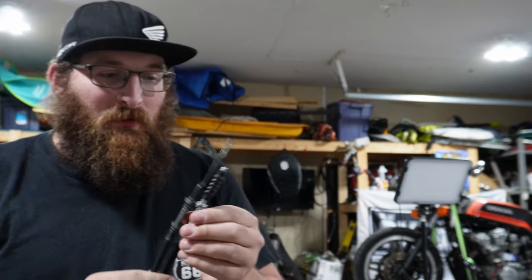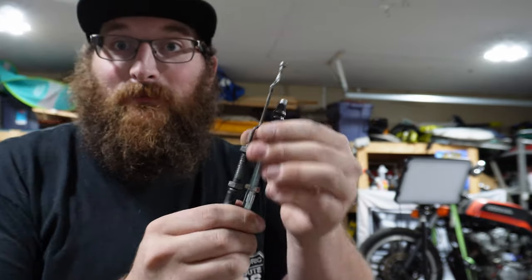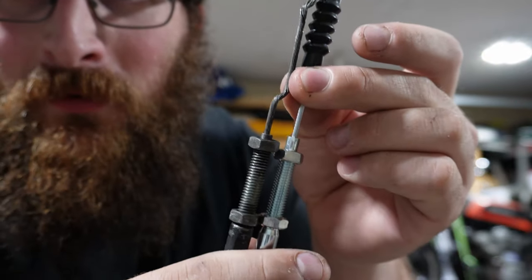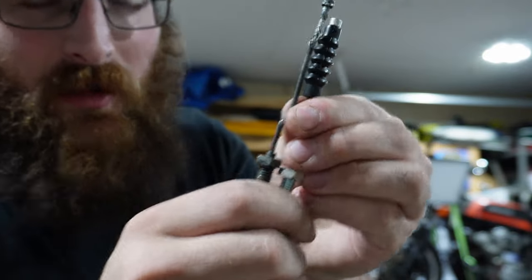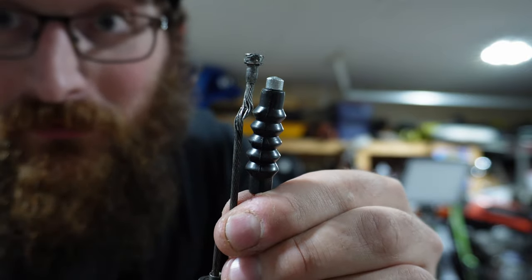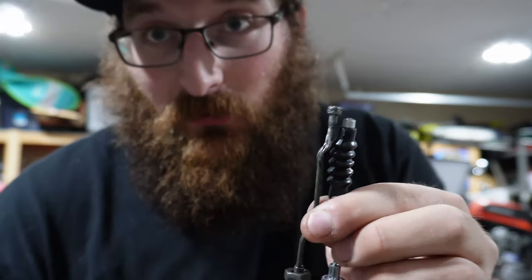Well, it's never easy. The new clutch cable that I ordered specifically stating that it fits a 1982 CB450T doesn't fit. The old one is kinked but also has about an inch on the other end. If I line it all up, the new one is still a quarter of an inch short. On the other end, the old one has about an inch left where the new one's tight. So the new cable is over an inch short compared to what it needs to be — not allowing even both ends to hook up without fully pulling in the clutch.